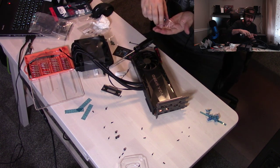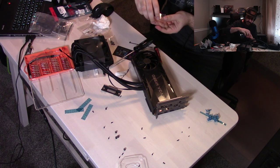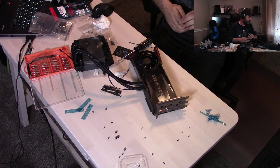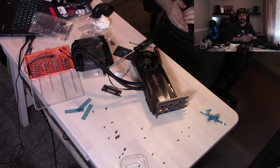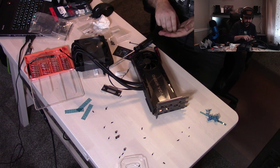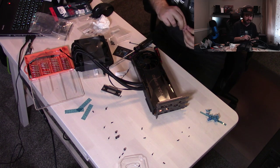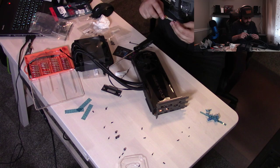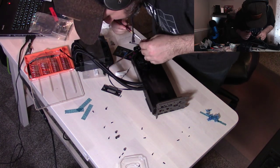Brandon, I was getting hot, I definitely was getting up towards 85 degrees. Now, when I took off my heatsink, I did notice my thermal paste was not very well applied from the factory onto my air cooler. So I probably could have gotten better thermals just by reapplying thermal paste without having to go through all this. But if I had to take it apart anyway, I don't mind. This is going to give me much better thermals now.